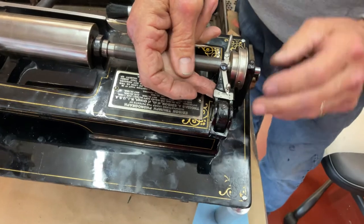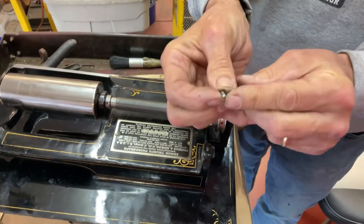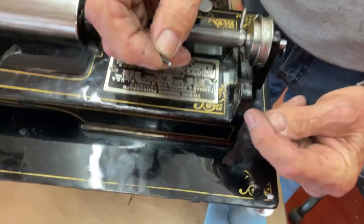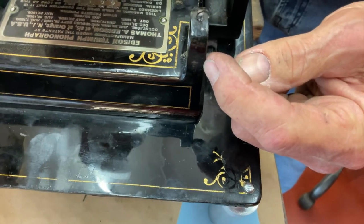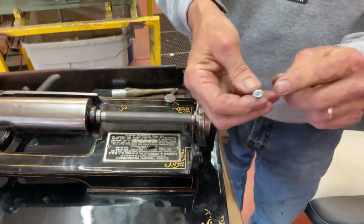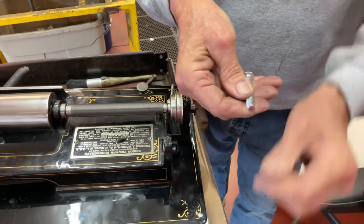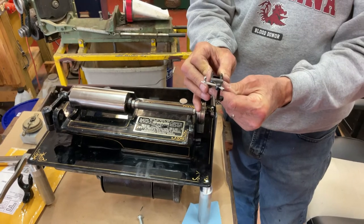And I kept wondering, why is it rising up? Well, I took the screw out, and I have tapered it down to a point, because you're dealing with the paint here, and I have a little wear mark — you can see a little shiny silver piece. The screw was not seating against the casting. So when I took the screw out, the end of it looked like this bolt I have, and you see how it's not flat? So it was running on the low side, and it was making the whole switch mechanism, when I went to 4, pop up like this. It was moving.